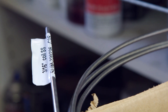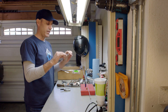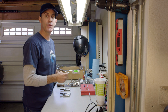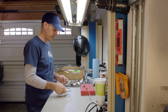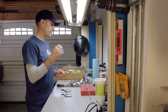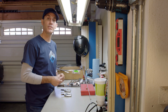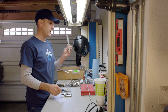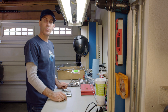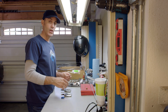Another way to go is with this stainless steel line right here. This stuff is really tricky to work with because it's very rigid, but it looks good and because it's stainless it doesn't rust and it lasts a long time. On the stainless steel line, you would use a 37-degree single flare — that's a specific tool, not the same as your 45-degree double flare tool — and you would use an AN fitting on that. Since over the years I've accumulated quite a bit of random parts, I think I'm gonna have enough to do the entire Mustang with this one coil of stainless steel and some of the fittings I have. If this is gonna be your first time doing brake lines, don't go stainless steel and AN — I recommend using the mild steel with an inverted flare. They're just so much easier.